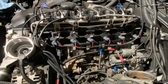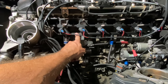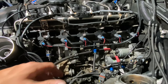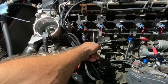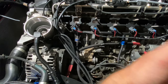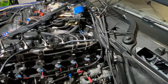So in order to get it more tunable and smarten it up, if you will, this pressure switch will keep a constant look at the amount of fuel pressure in the port injection rail. That will allow the tuner to have a lot more control to keep that rail pressure more steady. So this is one of the products that comes along with the Reflex that makes it such a great product. There are 3 things sitting in front of me here that will be running into the DME box to mate up with the Reflex.